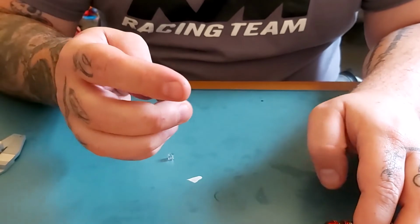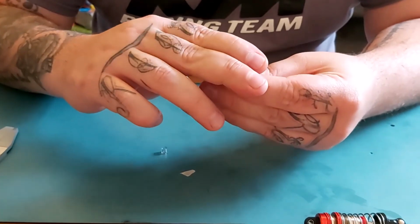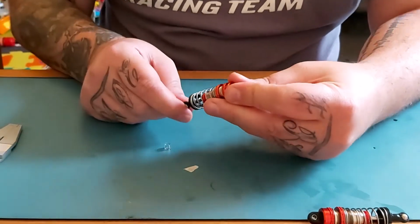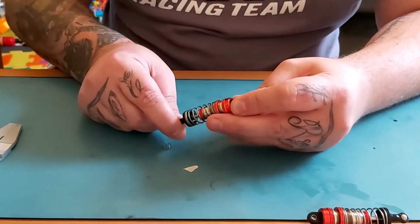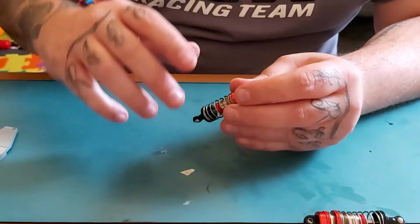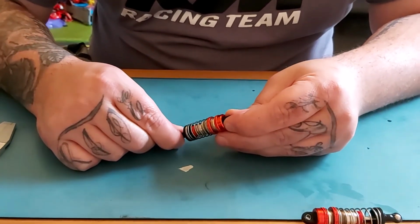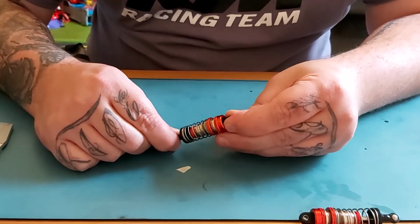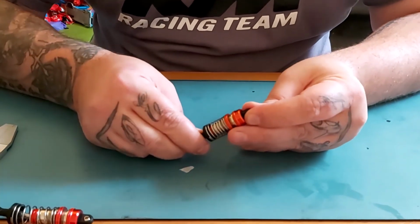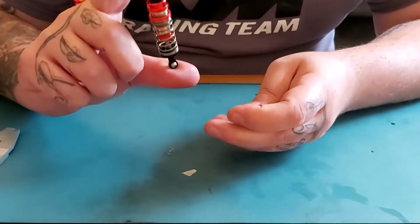And that's a good way of stopping the suspension bottoming out, especially on speed cars, as you've lowered the suspension to bring the suspension arm up. These compress in, so you have less and less travel, and you don't want big travel on a speed car, because if it jumps up, it messes with the geometry of the car. So as it's coming down, it'll stop itself, but it won't be jerky. Whereas if you use this one, it's going to hit solid, so it has some resistance to this one.